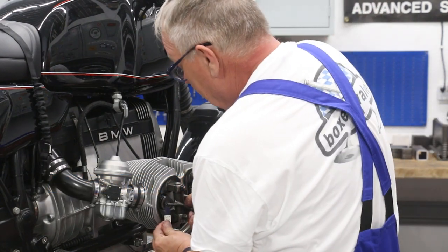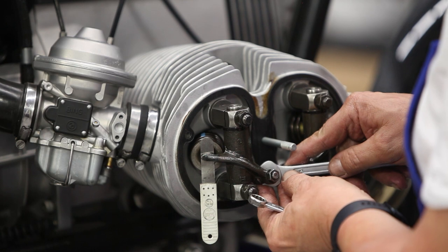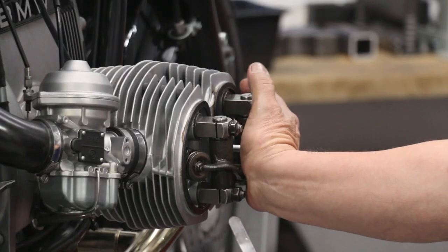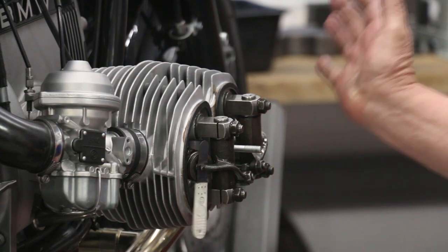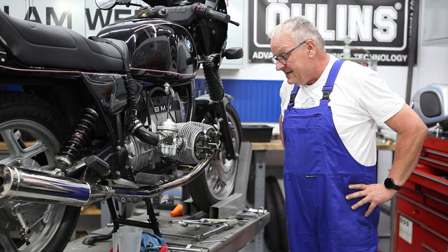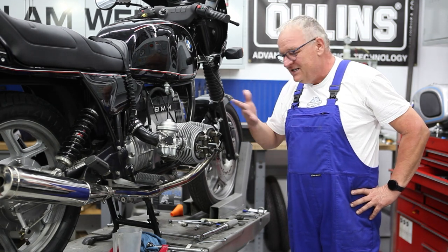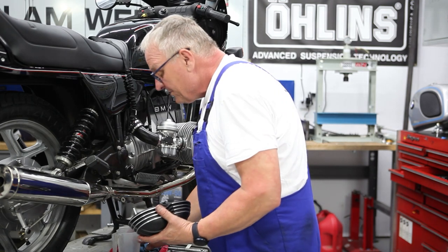The intake takes a 0.15. You can just turn it by hand until the feeler gauge stays put. Sometimes it requires a little trial and error to get it just where you want it. When I push it the gauge goes in very easily — fits perfectly — and when I relieve the pressure it seems a little bit on the tight side but not really. I believe the valves have seated in properly and it should stay put. I'll be checking it again at probably three to four thousand miles. I typically always check valve clearances every time I change the oil. Now I can put the valve cover back on this side and go do the same thing on the other side.